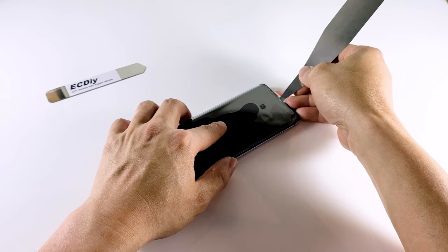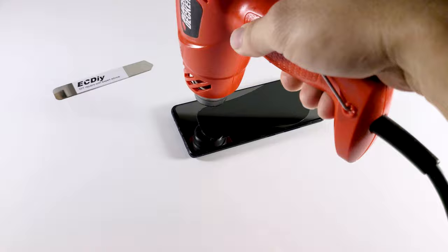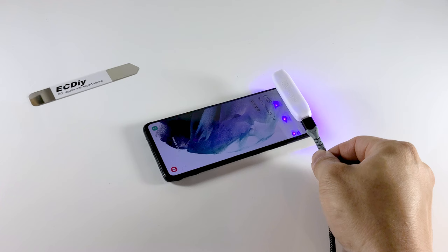Another super useful trick: letting the glue spread on its own is the best way to go. You'd want to do this on a level surface so it spreads evenly, and apply heat to speed up the process. Our glue is specially formulated to be hypersensitive to UV so that even the little bit of UV present in daylight on an overcast day is sufficient to cure the glue. Once the glue has just filled the display area, you can expose it to daylight to cure it. On a sunny clear day, it'll tack up in seconds and cure in under 5 minutes. We have a mini UV light available on our site as well for those who want more flexibility with the timing of the repair.